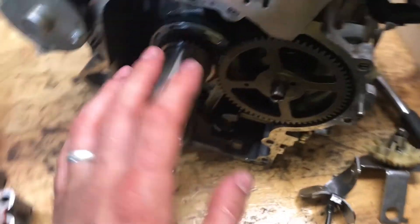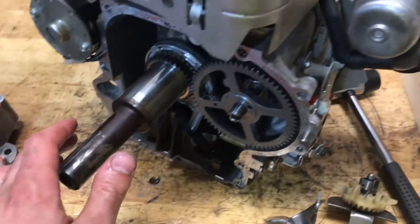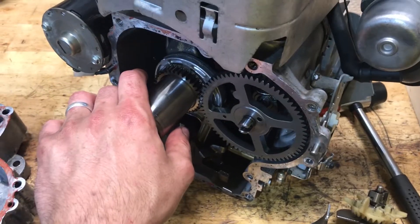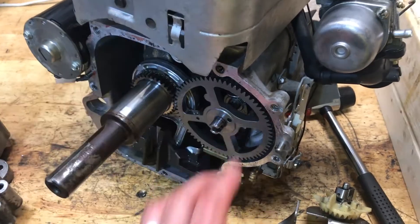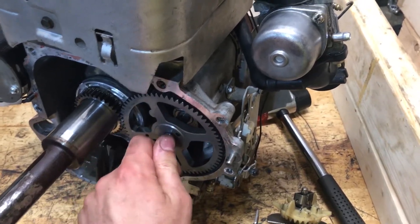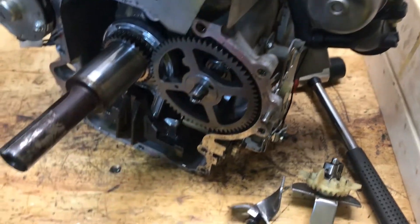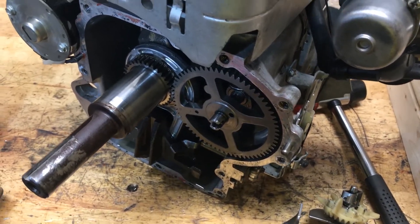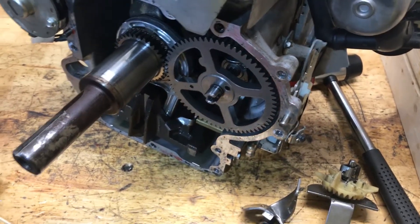What I want to do right now — and this is probably not smart; I'm just some novice dummy trying to take down a multi-million dollar company's claim — I don't want to order the part. The new camshaft is like 60 bucks. I just want to reassemble it without the flyweight and see what happens. They claim it can't get past the compression stroke.